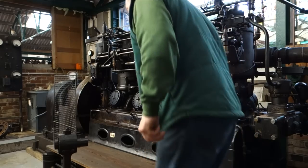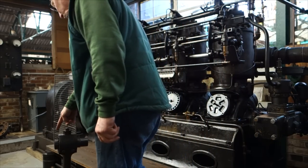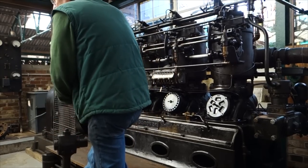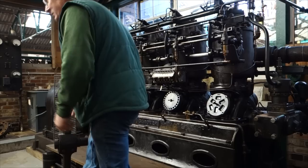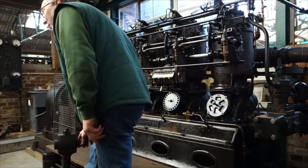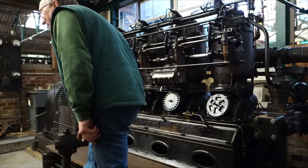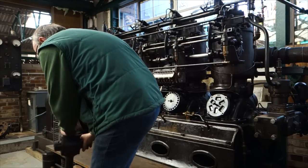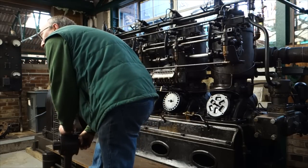The most novel feature on this is the design of the little end bearing. Two-strokes always have the gudgeon pin that connects the piston always loaded down, because you've got your power stroke and your compression stroke, so that point is always loaded — you often see two little ends on two-strokes. Well, this is a rolling design. There's nothing missing out of that — that's how it is in the engine. You've got an adjuster there to set it, and when the engine is running it rocks, and oil fed up the centre of the top of the rod lets oil get between the two surfaces.